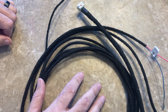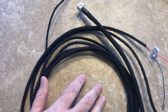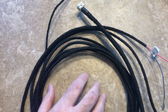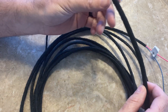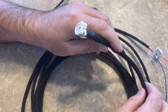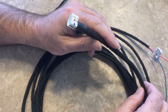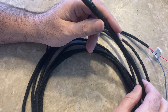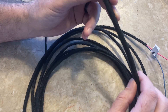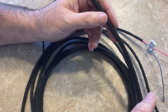I make this to go through all the factory connectors, so I just wanted to show how you need to unlock the factory connectors and pin the wiring. This is the actual connector for the camera, so you'll have to access it under the headliner when you pull the light out. You can plug this in and basically run this wiring over to the driver's side C-pillar.